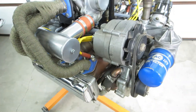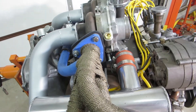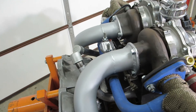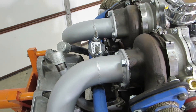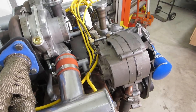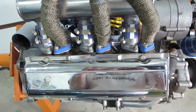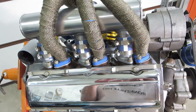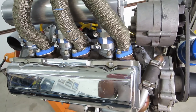Here's the other side. These exhaust housings are slightly smaller, or lower A/R ratio, than the standard B model. And here in the back is where the wastegate would be mounted that regulates the boost pressure on the engine. Let's get a closer look at these cylinder exhaust and intake ports. As you can see, they're very close together on the same side, and this enables — especially on the intake side — a very short runner. You need the plenums there to provide a reservoir of air-fuel mixture for the engine.